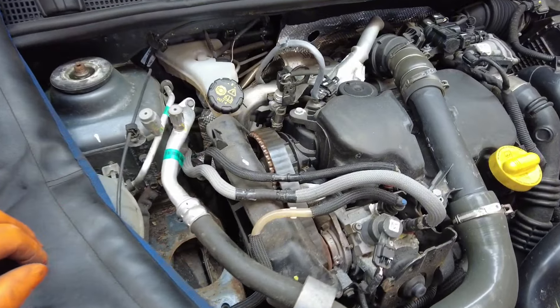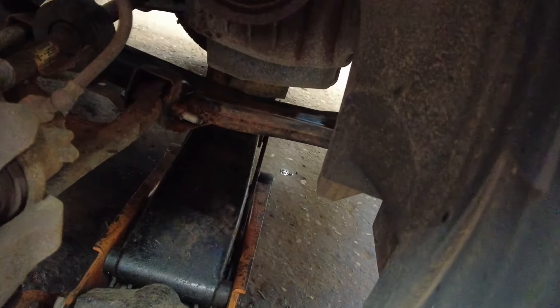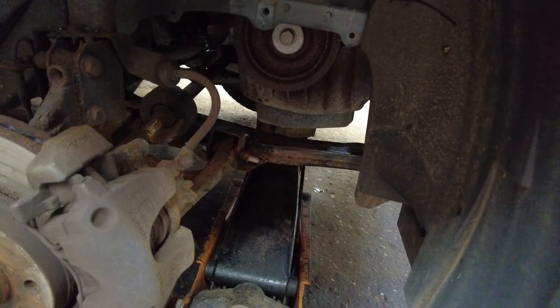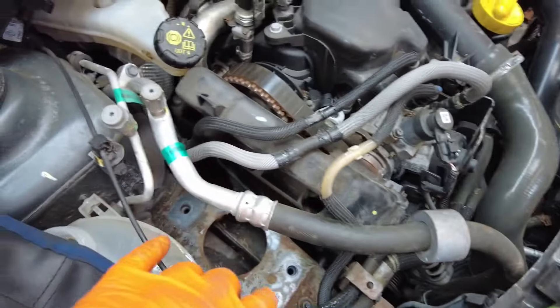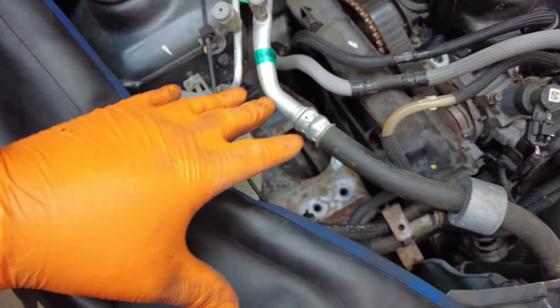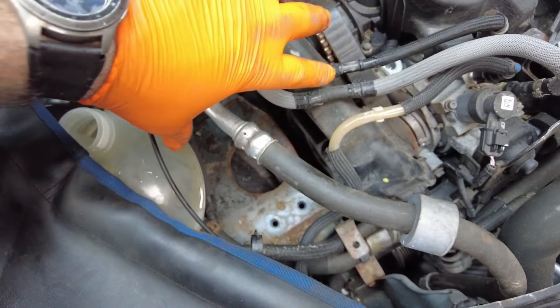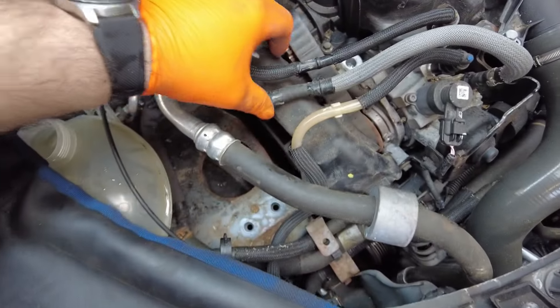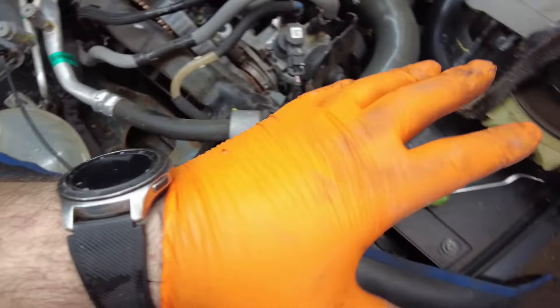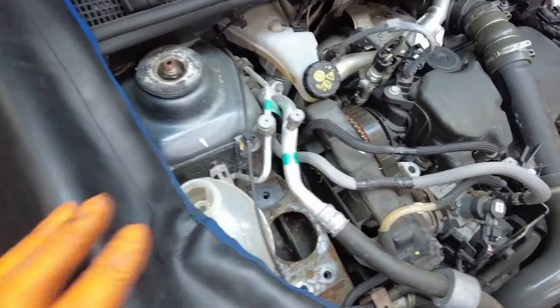With the vehicle back down to a working height, I've already gone ahead and removed the engine mount. How I did it: with a block of wood and a jack underneath the sump — always be careful because you don't want it cracking or denting the sump. To get the engine mount out, it would have been easier if I'd removed the air conditioner pipe, but it can come out with a bit of a fiddle — you've got to drop the engine right down as far as it'll go, then just move the fuel lines out of the way and squeeze it out. We'll put that to one side and get the upper timing cover off.